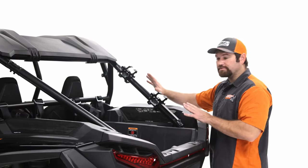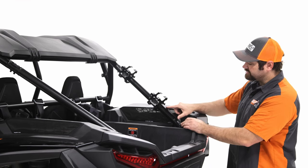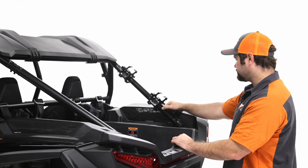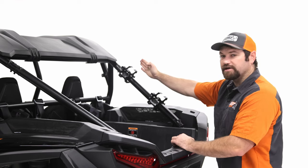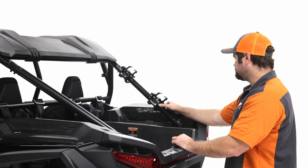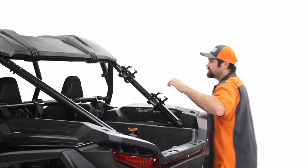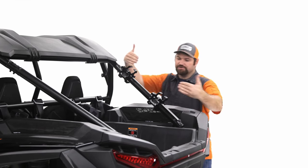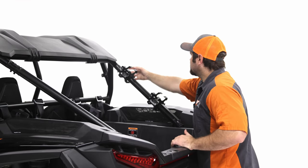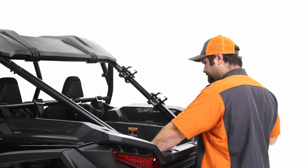So now that you have your hardware started on the top and the bottom bracket, we're gonna now set these spacers. So what you're gonna wanna look for is to align those spacers as straight as possible down the center of the tube. So you're gonna space them and move them into place, and just make sure that these brackets are pointed straight towards each other as best as you can. So you might need to make some slight adjustments. So that 15 millimeter that we had before, okay.